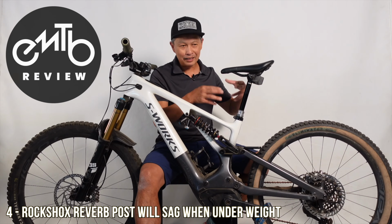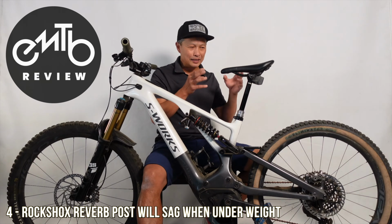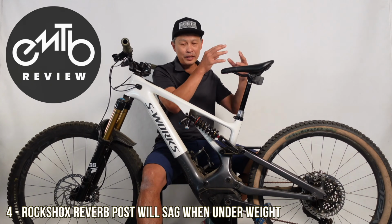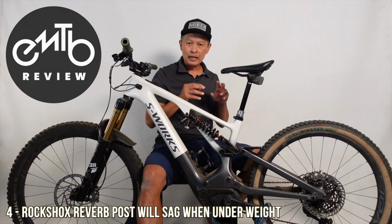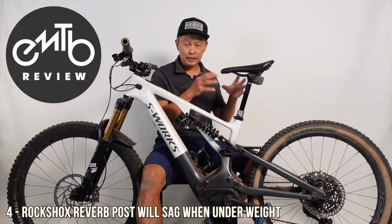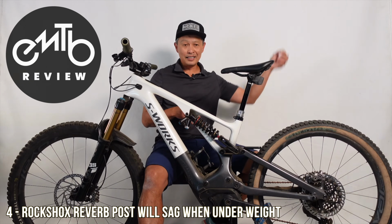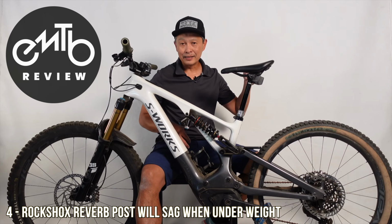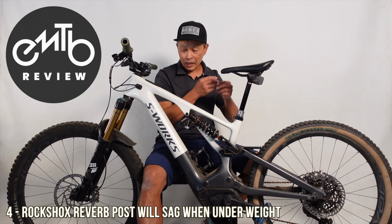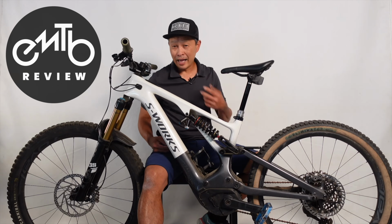I've had some that are like 10 millimeters, 15 millimeters, and this is one of your contact points, and it just interferes with the ride when you're pedaling or when it's down there. So luckily on the wireless one, you can just call RockShox and get a ticket number, ship this out. It's a self-contained unit, it doesn't have any wires, it doesn't have to be connected, and they can fix it separately without having a hydraulic cable that you need to disconnect and bleed.